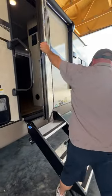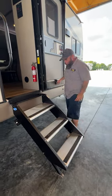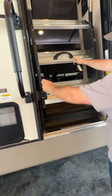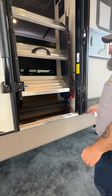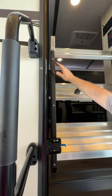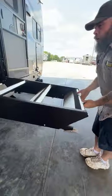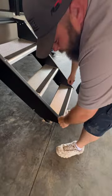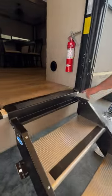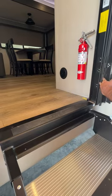Next, we're going to talk about our steps. This is basically going to apply for both the front and rear steps. You do always want to make sure your door is fully open when you go to put them up or bring them down. These guys here just lock right behind the little lip of the door — when the door is shut, it keeps them secured so they don't bounce all over the place going down the road. You're able to adjust the feet, and a lot of people will have them all the way dropped down and then manually adjust them from there. You do want to make sure that this here is as flat with the threshold as possible — too much of a gap or elevation will cause issues with both the screen door and entry door.